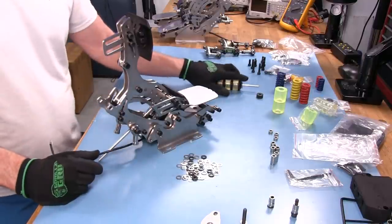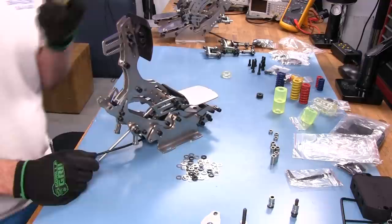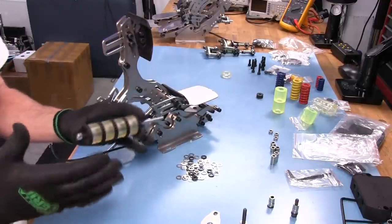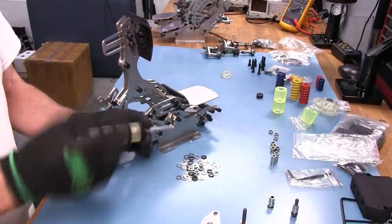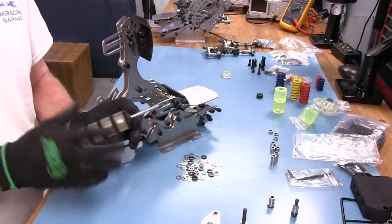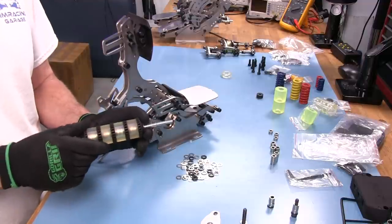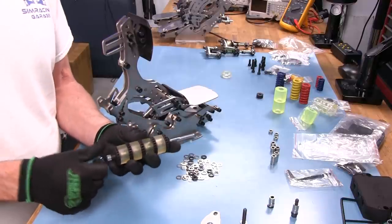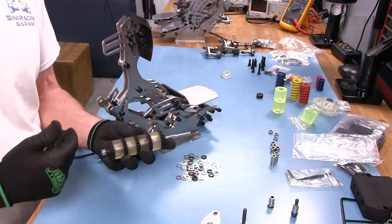So what I'm going to do is stay with the GT, because that's typically the kind of pressures I use in a brake pedal. And I'm going to go with that first. I might change it around later on, but this is something you could go on for weeks trying to tune a brake pedal. And I've done that, where I've tried a lot of different settings on a pedal and finally got it to where I liked it. And some I just couldn't get there. It's a very sensitive thing, and it's very subjective from person to person.